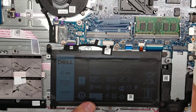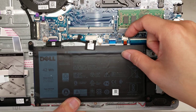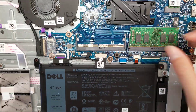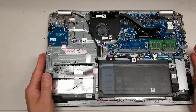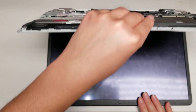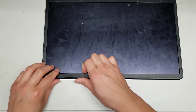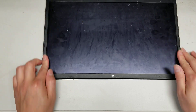All these connectors are about the same. For the little ribbon cable connectors, you just flip up the little latches and then you can pull the cable out easily. To replace the screen, it's not too difficult — the frame just pops out around the screen. You would go underneath, there might be some adhesive, and you just pop up the hinges. This one is broken so I don't want to take it out, but the plastic frame is broken.